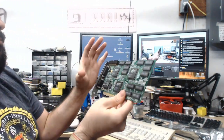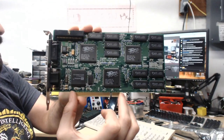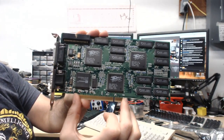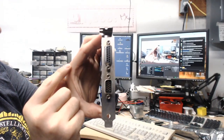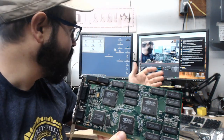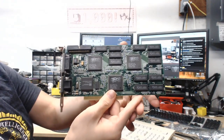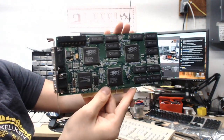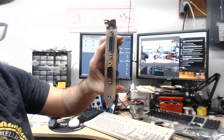So this is the Voodoo 2 card for the Macintosh. It looks very similar to the PC one, except you'll notice the video out port at the top is a Macintosh port. So there you go. Well, hello there, and hello from New Jersey. Thank you for watching. This is a Voodoo 2 card for the Mac, and as we said, the video port here is a DB15. It's not the VGA port like the PC version has.